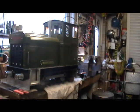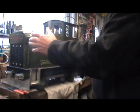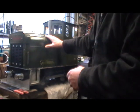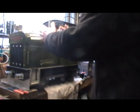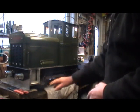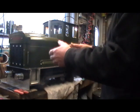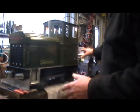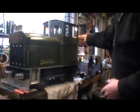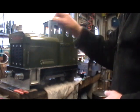I'll quickly explain what the upgrade is going to entail. I've got to go into the battery compartment and change the wires on my batteries over — I've got to turn my batteries to run in series instead of in parallel. My two batteries are currently in parallel on 12 volt. I've got two motors underneath, one on each set of wheels. I won't need to change any wiring to those; they'll just stay as they are but they'll run on 24 volt.